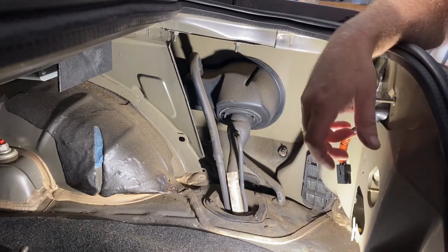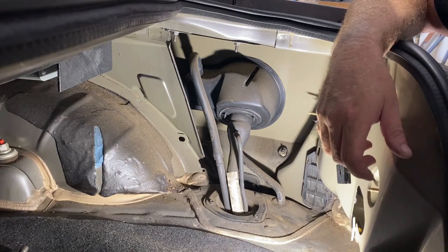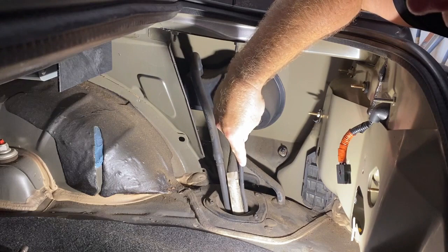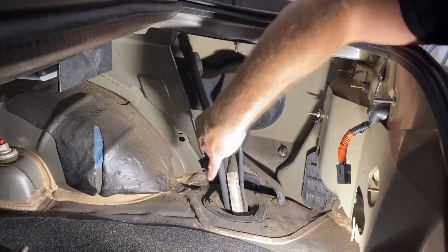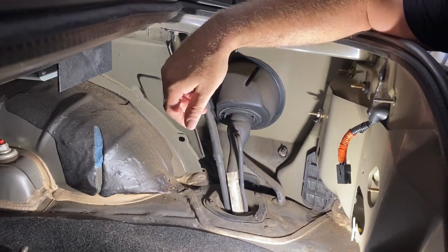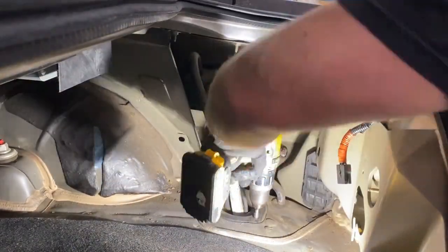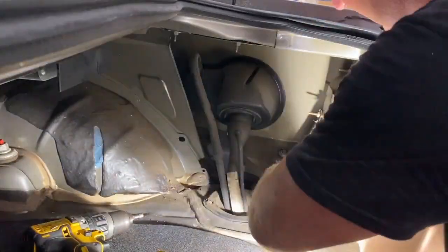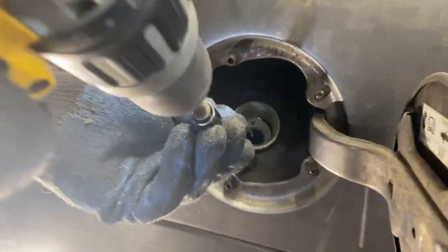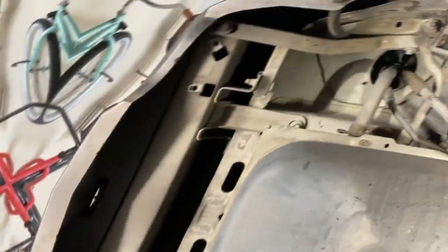I had all the stuff from the interior back here, now it's all back in the interior — which is fine because you've got to get to the shock top mounts over there anyway. Here's our fuel filler neck. We're going to remove these 5/16 screws here, and then I think that's a 10 millimeter, and start working our way out of it. It disconnects these lines underneath.